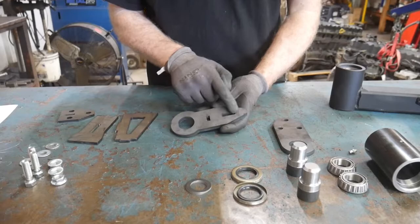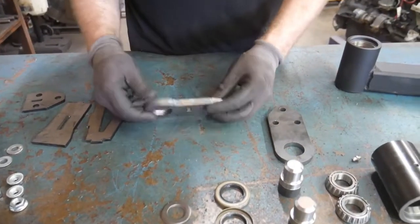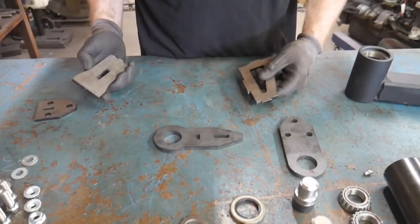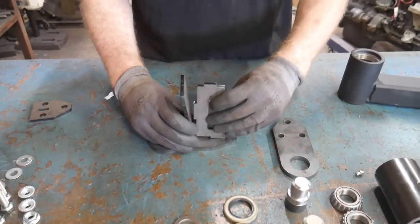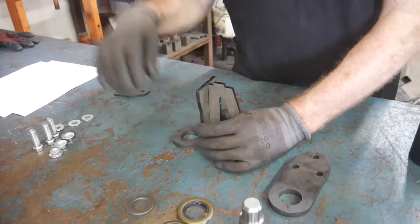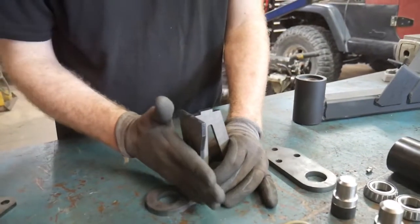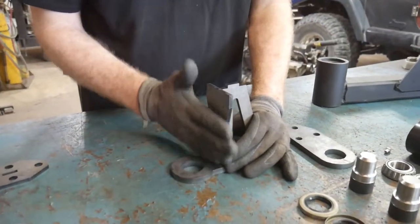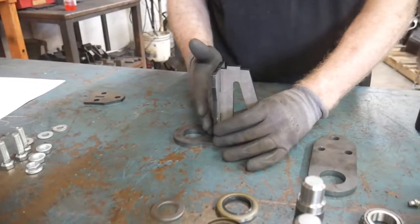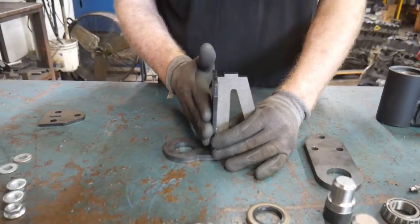Alright, to start the assembly, we'll look at the plates, and this is the base plate. You can tell that because there will be a couple of slots in here, and those are to locate the other pieces. Now this plate can be placed either way. When you're going to assemble this, the first couple pieces you're going to want to put in are these two pieces here, and they will kind of snap together there. The main thing you're going to want to make sure is that this plate here is perpendicular to the sides and also 90 degrees straight up and down. If everything has gone together well, it's pretty much going to set itself right there, but I would recommend going ahead and checking that to make sure.